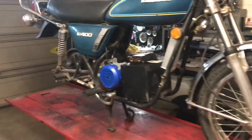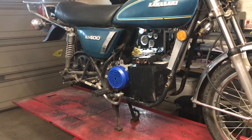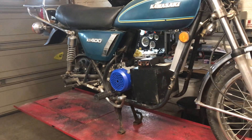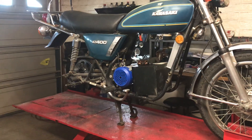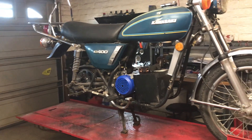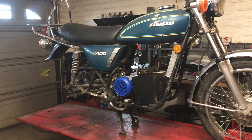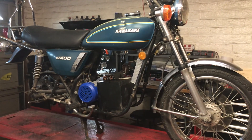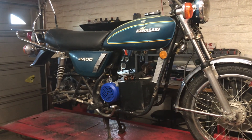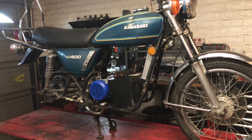On a budget, the motor only costs $109 and it gives you a 48 volt 1000 watt brushless DC gear reduction motor. Everybody does these budget builds with golf cart motors and brushed DC motors — don't do it. You can look up all these videos on how to build an electric motorcycle and they're all using brushed motors and filling the whole compartment with lead acid batteries. Budget yourself on the motor and you'll have more money to get lithium batteries, and then you'll get speed and range.